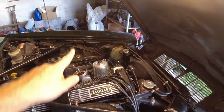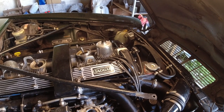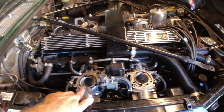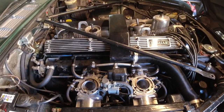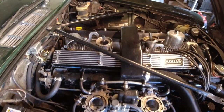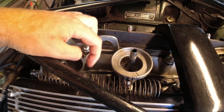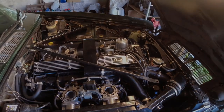So the plan is to fill up the coolant to the maximum, make sure there's some in the coolant reservoir, then get the new pressure tester and pump it up to 16 psi — which is what this system's cap is rated for. Then we'll wipe the carb area clean with a paper towel and see if anything comes back. If I don't see anything, we can look inside cylinder number two with the bore scope camera.